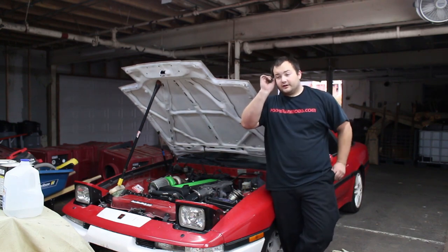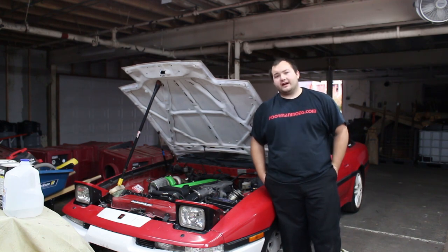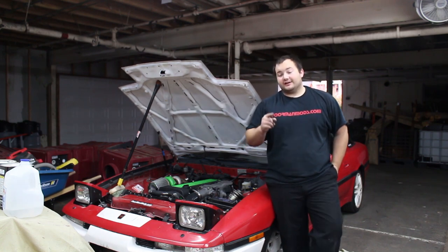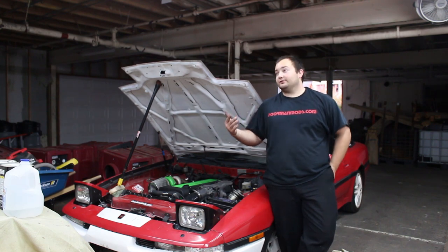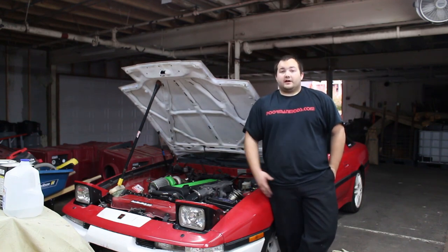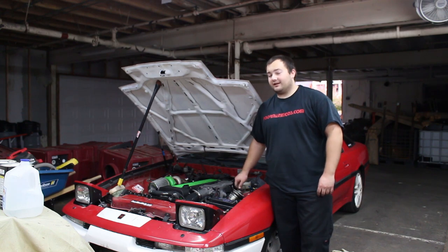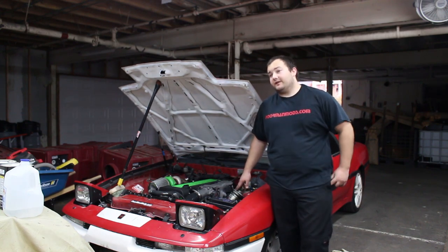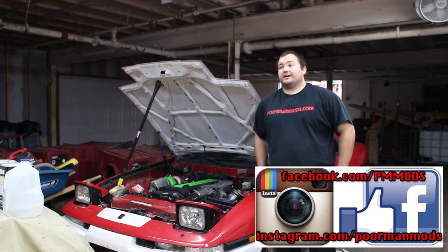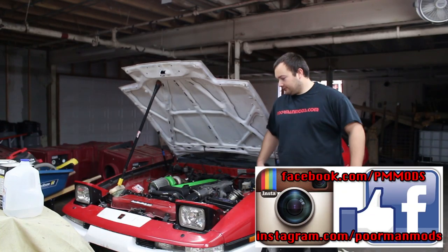When I go to start this car, these injectors are about 42% larger than the factory injectors, so it should be running pig rich. That's why in our next drift missile episode we'll be showing how to tune it with the Apexi Neo, and hopefully we can up the boost and make gobs of power. This swap is probably cheaper than doing the 2JZ 550cc injectors, because with those you need to wire in a resistor pack. With this one there's no wiring — I'd rather just cut the tabs off the injectors.